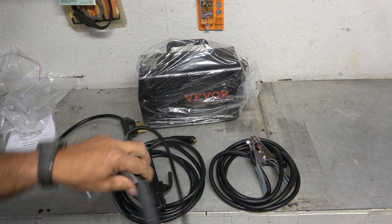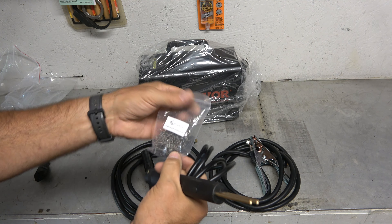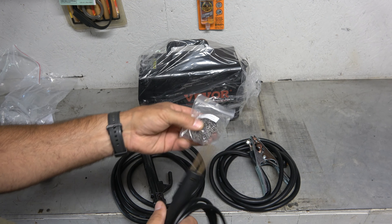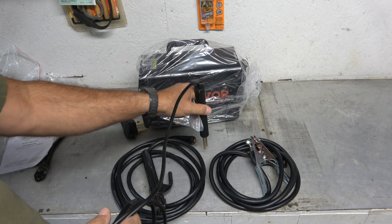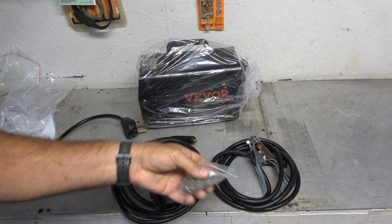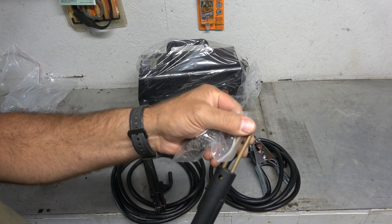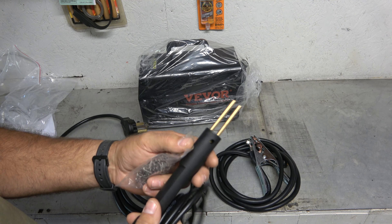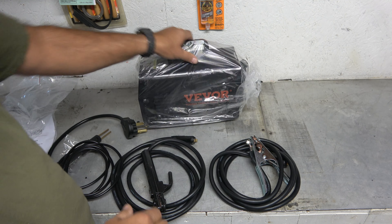Here's what I was talking about. It's got two little holes in there, and it does come with a whole bunch of staples — 0.8 millimeter wave staples. You put those in and weld them. This heats up those staples, you press down into the plastic — not all the way through, just enough to get started. You pull back, and you can either fold over or snip off the legs that come off. You've created a stitch, like putting stitches into broken plastic. These are fairly new technology, at least for the consumer, and I think that's a really cool thing they've come up with.